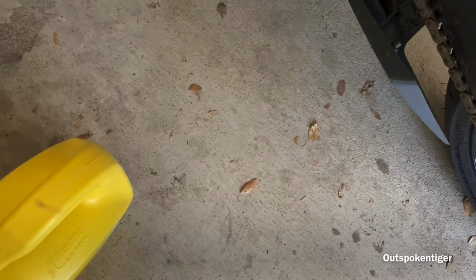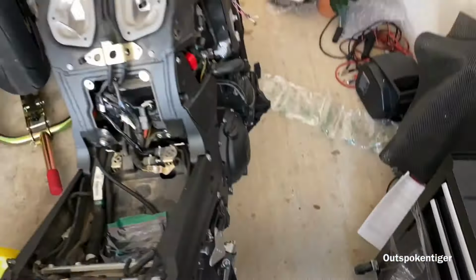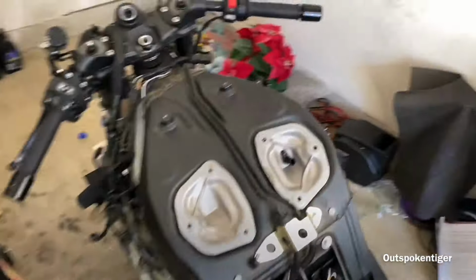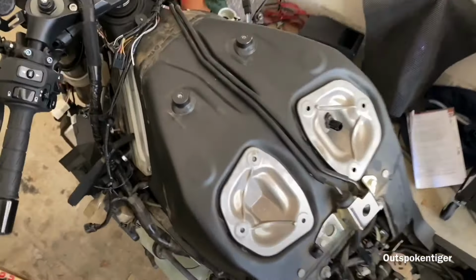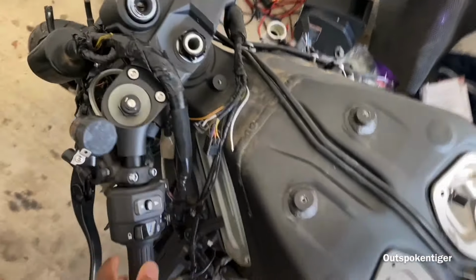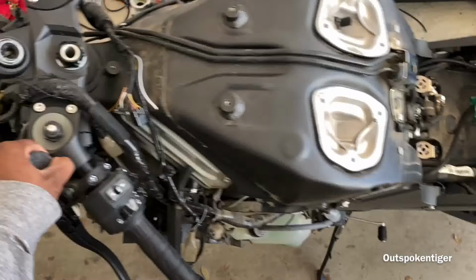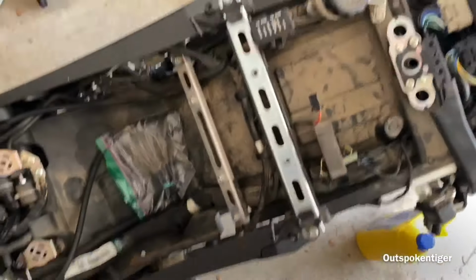So as I'm spraying, I'm gonna keep the RPMs low. I'm not gonna extend the rev range. I'm not gonna do none of that crazy stuff. I'm just gonna keep the stock gearing, the stock RPM configuration, pretty much as close to stock as possible, because like I say, spraying a nice size shot high up in the RPMs can cause some issues.